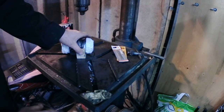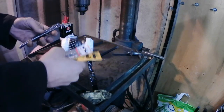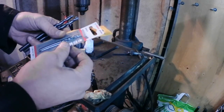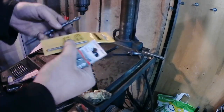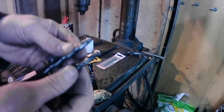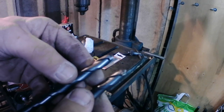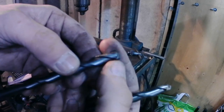So we've got the gear here, it's in the jig — I'm quite happy with that. From what I've seen online, some people say that you don't need to sharpen your drill bits, and some people say you do. So I've sharpened two of them and left these two as is, out of the packet. We'll try the unsharpened ones first and see if you do need to sharpen them. The one on the right is more like what you'd find on a traditional metal-sharpening drill grind; the one on the left is just as it is out of the box.